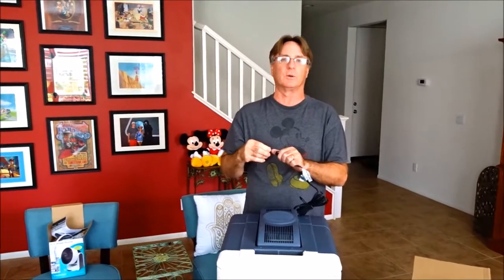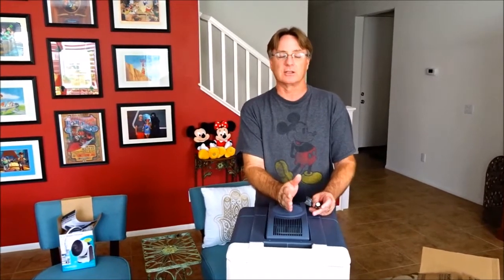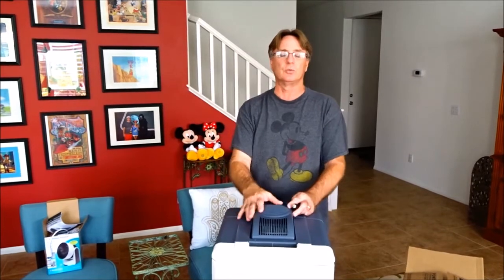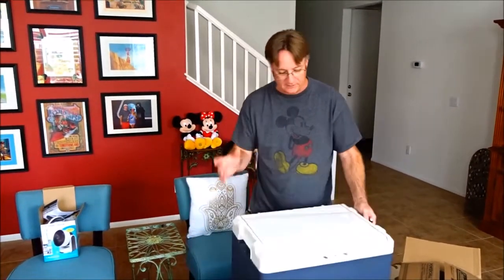For $300, those weren't really worth it because of the power consumption and such. These are mid-range coolers — they just plug into a 12-volt outlet but they are not a full refrigerator; they just help cool. You probably still want to keep some ice in this. They cool down the surrounding temperature by 40 degrees, so if your van is 90 degrees, the stuff inside would still be 50 degrees — which is still too warm for milk. So these are just a good help; you would still put ice in it.